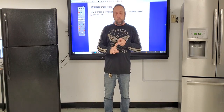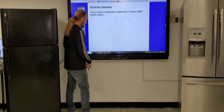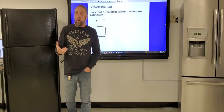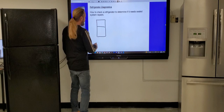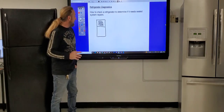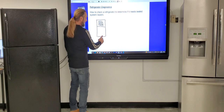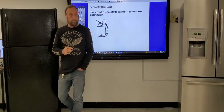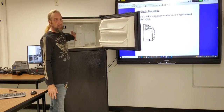We're going to talk about a simple refrigerator with one evaporator, one compressor, and a fan to circulate the air throughout the box. We have two different types of refrigerators here. The first one is a top freezer — a top mount — where the freezer is in the top. In most refrigerators, the sealed system is in the freezer. The evaporator is where all the cooling is done in the box — it's absorbing the heat. There's no refrigerant system in the refrigerator section at all. The compressor and condenser are down here, and freon is pumped up to the evaporator and back.